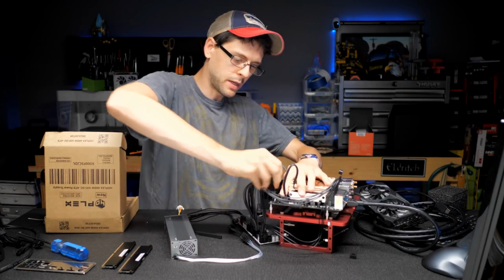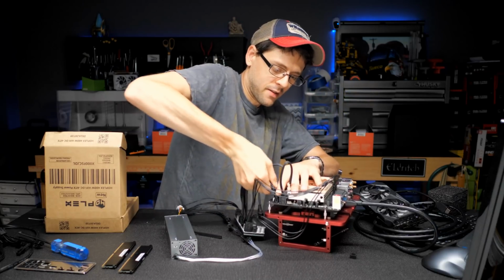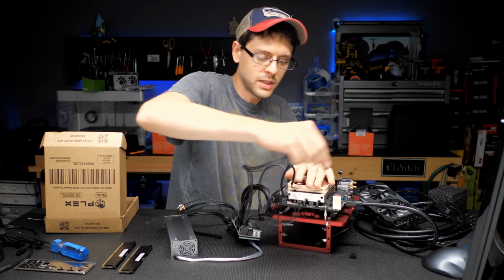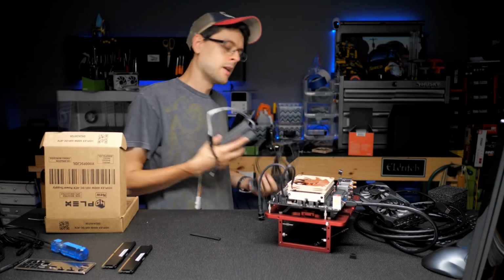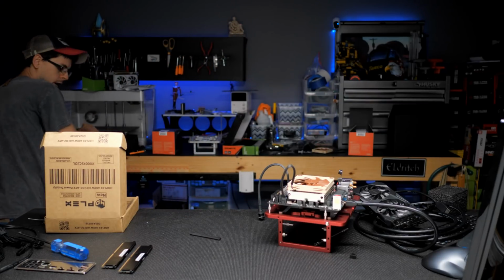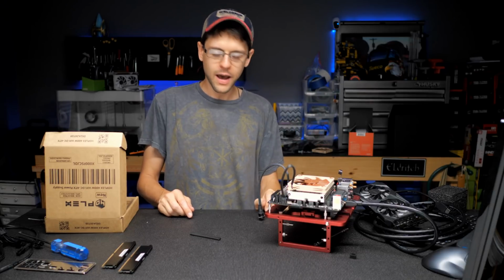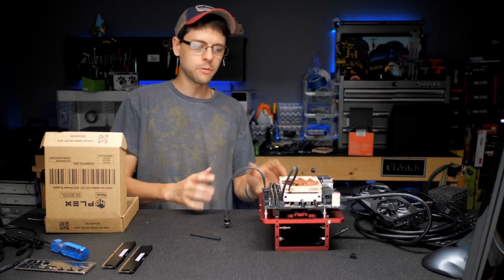So in my experience building computers, and this is just my experience, yours might be different, I used to have a saying, it's always the power supply, because it was mostly the power supply's fault if you had posting issues. But since I switched to these types of power supplies, I kind of changed that to RAM. And there's another issue with RAM. A lot of RAM, you actually will have to go into the UEFI and make changes to your motherboard to get the RAM to be quite stable.